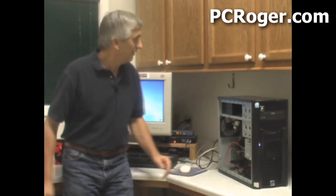We're pretty much finished with just a little cleanup to do. We powered down the computer, disconnected the old hard drive, and connected the new SSD to the primary serial ATA cable inside the machine. We fired it up with a stopwatch and found that not only did it work — the machine booted Windows 7 as expected — but boot time decreased from 44 seconds down to 32 seconds, lopping off about 25%. But that's not where you'll see the best performance increase. In day-to-day applications with a lot of windows open, that hard drive light won't be on solid anymore. You'll have less heat, no moving parts, and while the SSD will wear out in time, it's a lot of time — and you'll enjoy it a lot better.